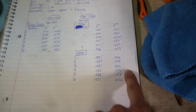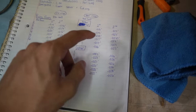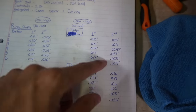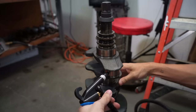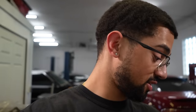After about five or six hours I'm done gapping the rings. I left the second rings exactly as they were — I just measured them very meticulously and made sure they're even all the way around. The difference in readings makes clear you have to be very careful how you measure, because it matters a lot. Now I'm spraying some air through all the journals of the crank to make sure everything is clean. I'll install these bearings and use some plastigage to check clearance, since I don't know the service history on either the block or crankshaft.